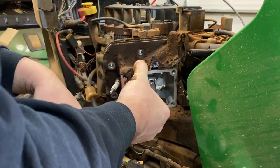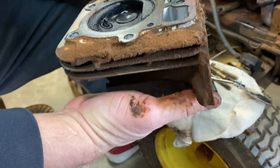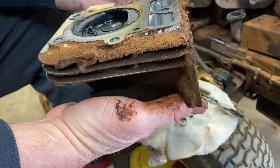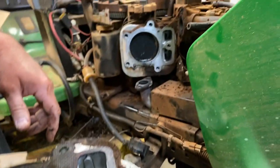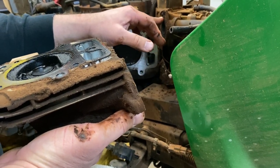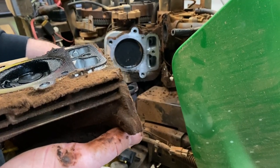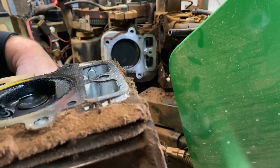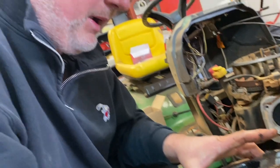This head should come right off now. And there's our cylinder head, guys. We got a gasket stuck to it. We're going to clean the surface of it all, inspect this piston a little bit, and get all this cleaned up. We'll get some of this dirt off. We got new gaskets for our intake — looks like an O-ring — and a regular gasket for our exhaust. There are the two dowel pins that dialed it in place. All right, we're going to work on cleaning this stuff up, then put it back together and see if she runs.